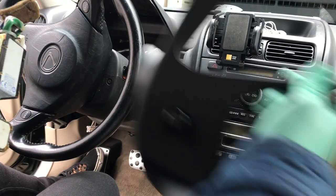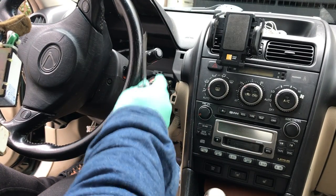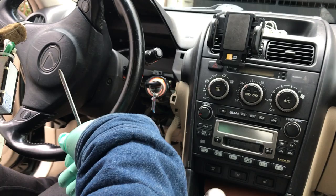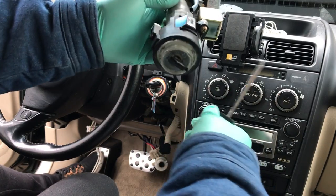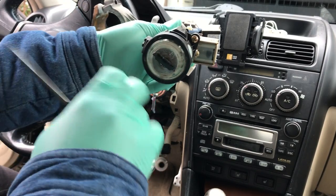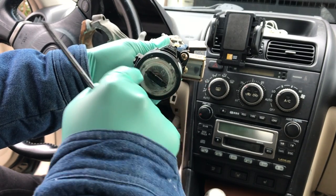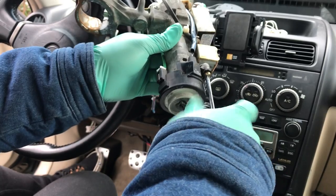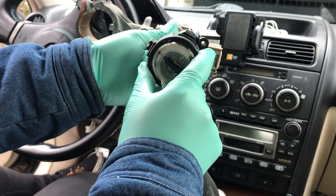After you take the lower panel off and the housing for the speedometer off, you can get access to the cylinder. I actually do have my speedometer out — the only reason I took it out is because there were two bulbs behind it that blew out, so I figured I'd change them now. When trying to access the cylinder, you'll see the sensor ring is still on here. This is what allows the chip in your key to send a signal to the computer to start. You're going to remove the sensor ring.